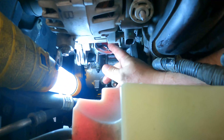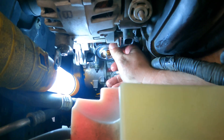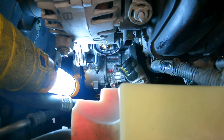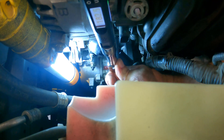We will now clean the gasket material from the housing and opposite surface. Leave no old gasket behind as it will cause a leak. Next, place the thermostat into position with the correct side up. The vent hole allows for air to circulate through the thermostat and needs to be facing directly up to operate properly. Make sure to use a new gasket with the new thermostat. Now we will tighten the bolts to the proper torque on the thermostat housing. If needed, reinstall the radiator hose.